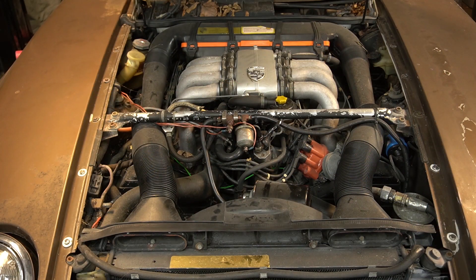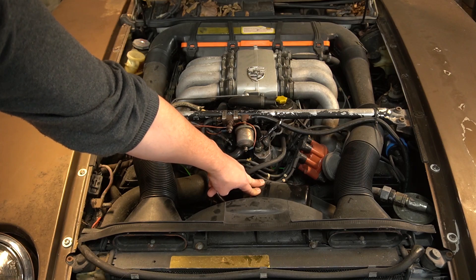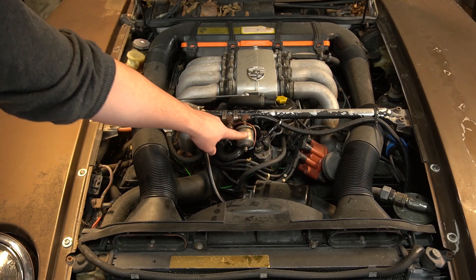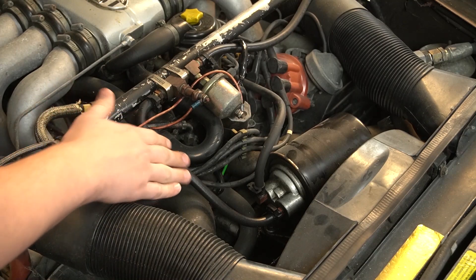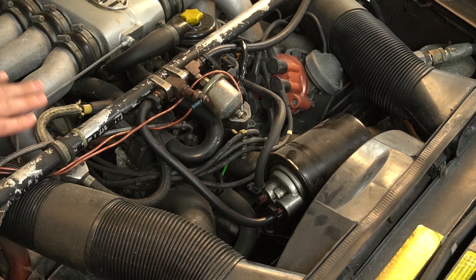Under the hood of this 1980 Porsche 928S Euro spec, I'm finding some interesting stuff. A lot of the emission equipment is completely different from my '84 US model. I'm also noticing some odd parts I'm not able to identify. We have an additional filter here that looks to be connected to the oil supply — it drains back into the oil fill and runs to two sensors in-line. I believe these are oil pressure sensors as they have wires going back through the firewall. It seems like we have additional in-line filters for both the engine oil and the transmission.